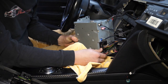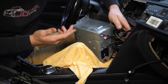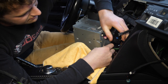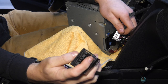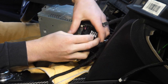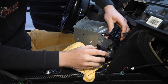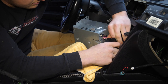For the main harness itself, we need to flip this big black latch backwards and pop it open — that will force this connector out from the factory head unit. For those with the optical connection — a black wire and a green wire — take a pick tool and pop the little clip loose holding those two wires in, then remove the optical cable from the factory connector. Take the new Motive Supplies harness, take the male end, plug it into the two holes on the connector just as it was before. Make sure it clips in. Open up the latch, plug this new connector into the factory head unit, latch it down, and make sure it locks into place. Then take the factory male connector we just unplugged and plug it into the new Motive Supplies connector, and lock it down with the latch.